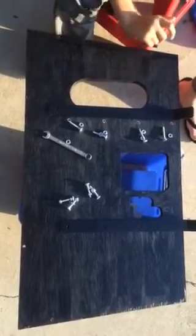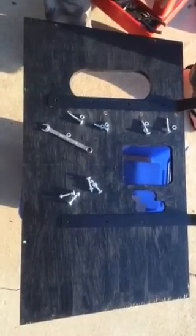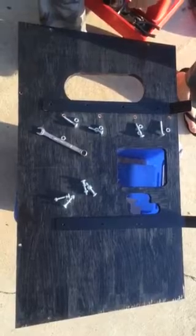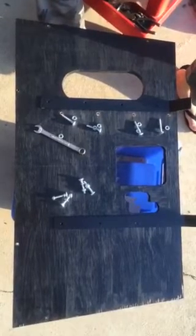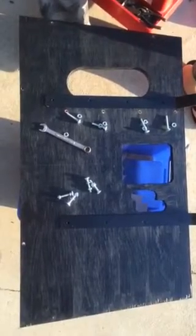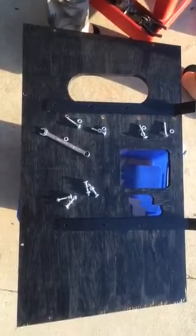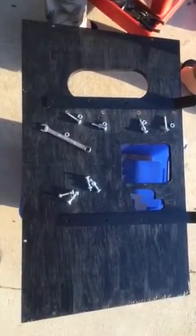The beginning of 1928, Ford used the wood engine slats from their crates and did the floorboards. But then around March of 1929, they went to plywood flooring, which we're replicating here. We've gotten a hold of an original factory blueprint, and I made this plywood to the factory blueprint.